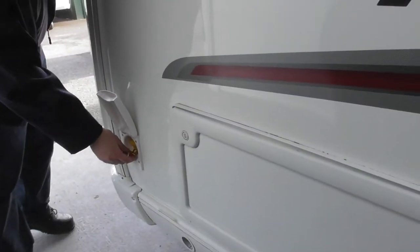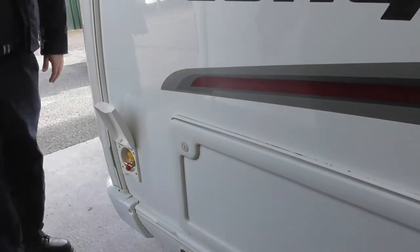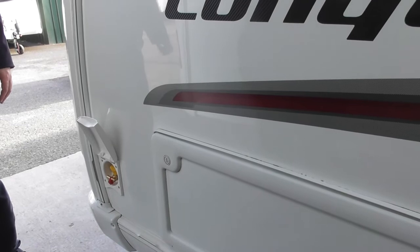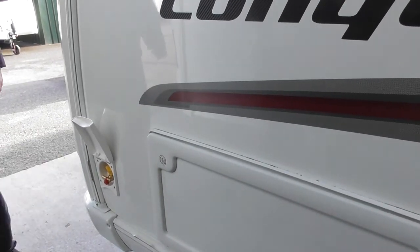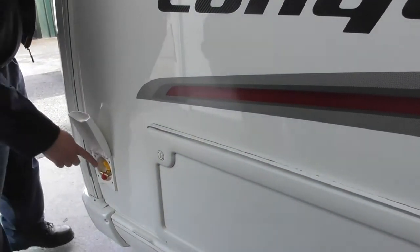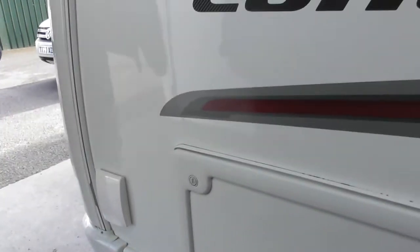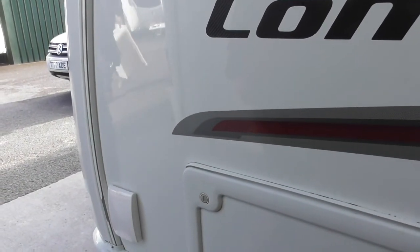In the first cupboard, the main thing to show you is the alarm box in the back. It's fitted with a tilt sensor alarm as well as a motion sensor inside. If anyone picks your van up it'll trigger the alarm, and if anyone moves internally it'll trigger it again. When fully charged these alarms run for three months standalone — even if you take your leisure battery away. When you plug back into the mains it charges the leisure battery and also charges the alarm battery back up.